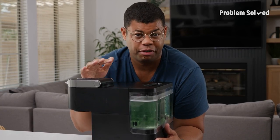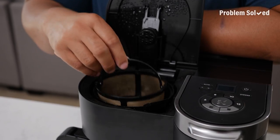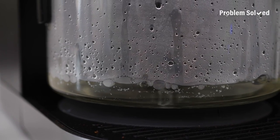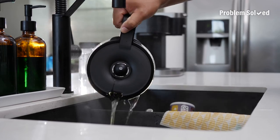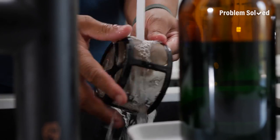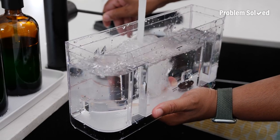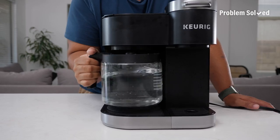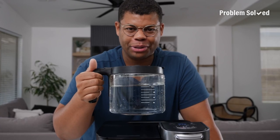This works on all coffee machines — traditional and single serve. Then run your coffee maker like normal, without coffee of course. Run the machine with the denture tablets until the reservoir is empty. Then fill the tank up with clean water and run it again to rinse everything out. Once the water runs clear, you're ready for a fresh brew.